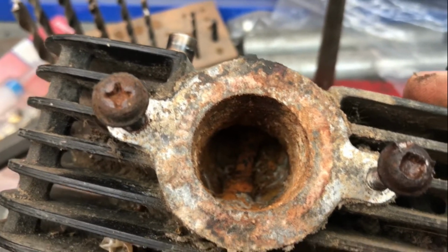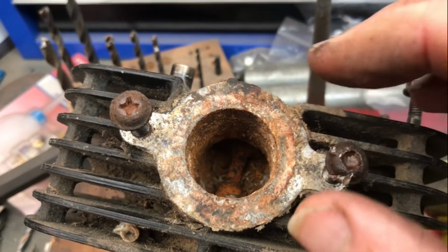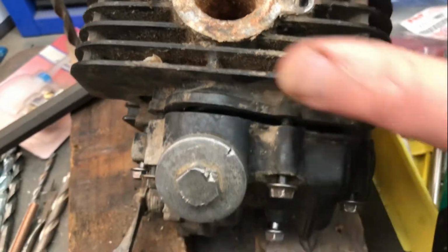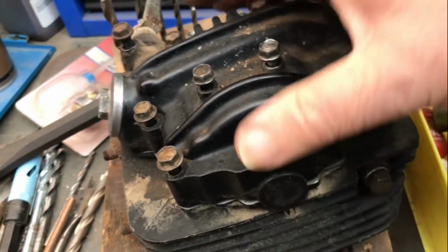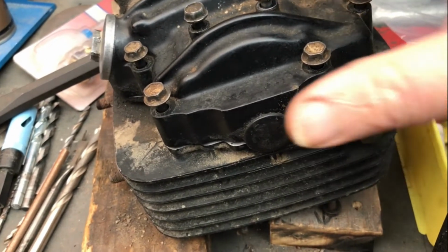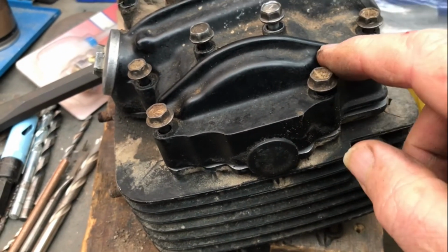Mess things up inside there, so I don't know whether this cylinder head is toast because of that, or it's going to go in the spares box anyway to keep it on hand in case there's other parts. I worked out that the camshaft I'm using in the 94 engine is actually the one that was in this cylinder head. I had a close look. These pieces, I'd had the cam cover. In fact, this was in pieces. The cam cover was off separated from this base, and I had to actually try and match which cam cover matched the cylinder head, and because they looked very similar, it was really on the RTV that I determined that this one matched this head.